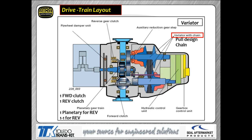Either you're going to have the forward clutch on or the reverse clutch on. If stationary, you'll have slippage through those clutches. The planetary for reverse establishes the reverse gear position. Just like the Chrysler Jatco CVT we covered, when you select reverse the transmission goes into a fixed ratio for the pulleys — same thing happens here. You can see the variators, pulleys, chain, and the pinion shaft going through the middle.